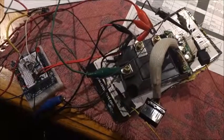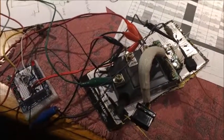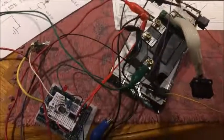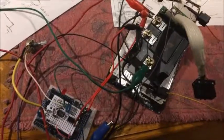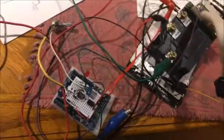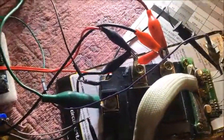This is a confirmation of IGBT number two from the RAV4. When I turn it on with 12 volts only — to run the pulse width modulator and the lamp across this thing — the IGBT turns on despite no power and no signal to it.